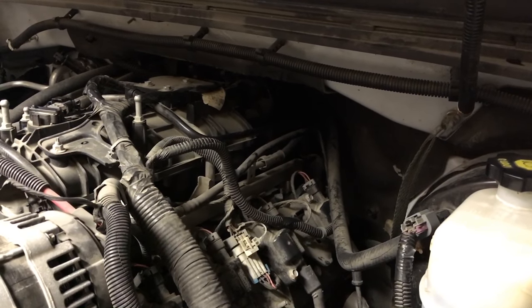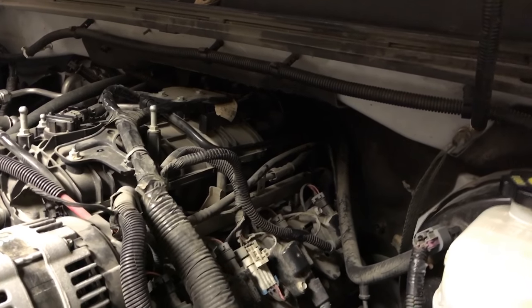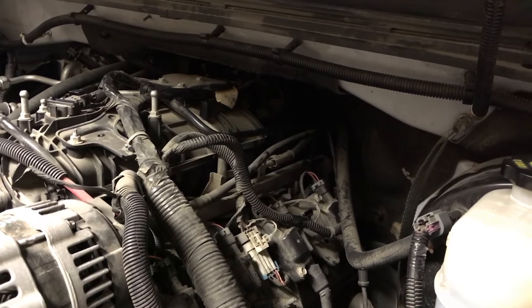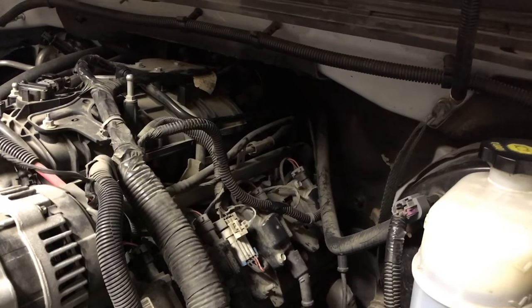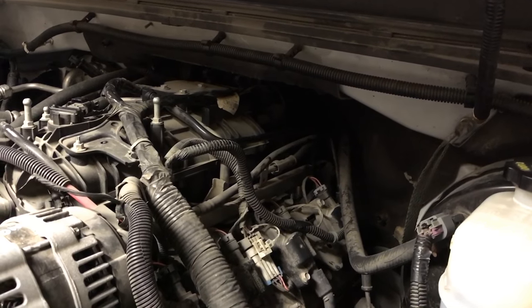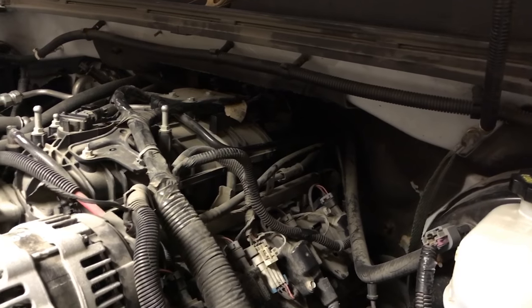I always replace the sensor just for good measure — just to be sure you don't have any issues down the road. For example, you could have one starting to sludge up and not even realize it. My truck always ran at about 40 PSI oil pressure — not too bad, it's got 114,000 miles on it. After taking that screen out, first startup it bumped right up to 55 PSI. It'll go down a little after it warms up, but even warm it's staying over 40 PSI.